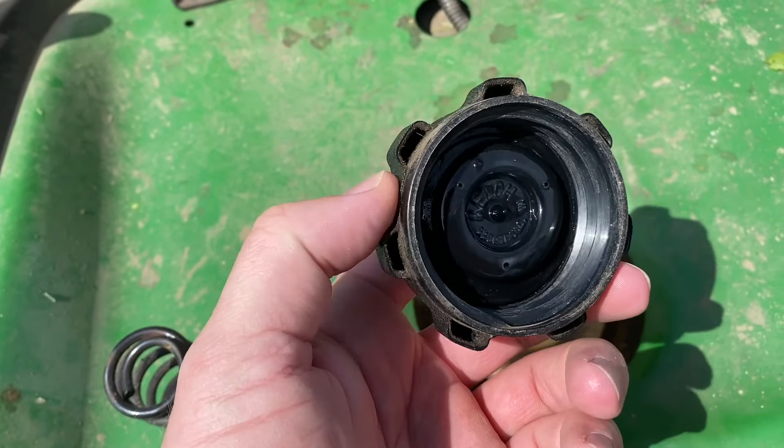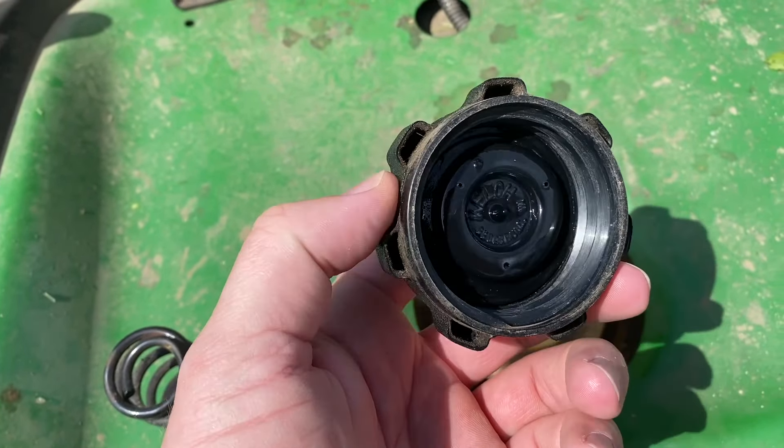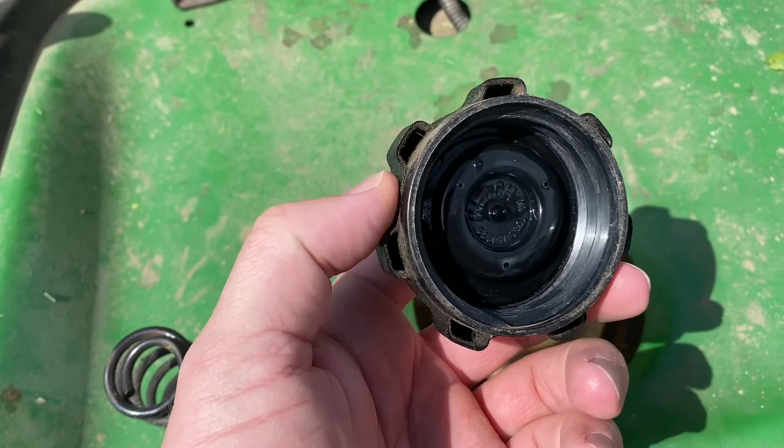Did you hear that? There was a whoosh of air. This cap — the ventilation is getting clogged somehow. Just undo the cap. The tank is under vacuum, that's what it is, since that cap's not ventilating. Hop on — this should fire right up.